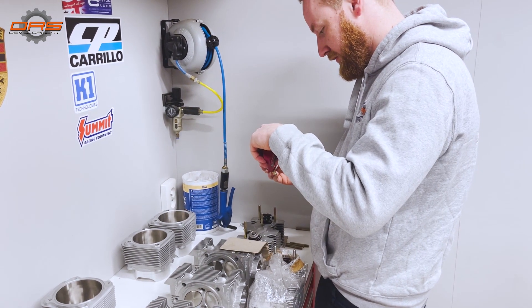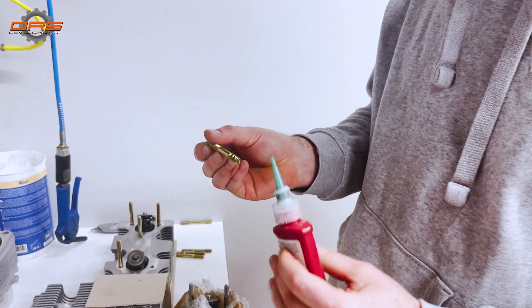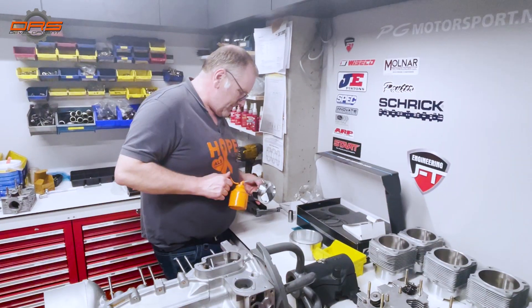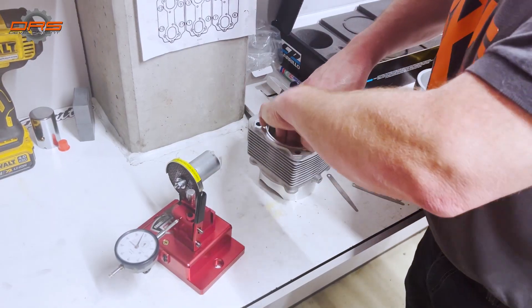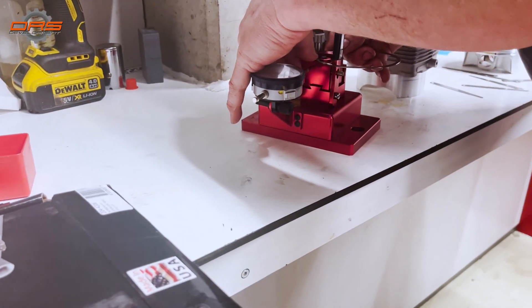We roll-plate all of our head studs — everything on the engine is redone. I used a little bit too much glue on this one, but I took it off, no worries. Philip is assembling the piston rings and the pistons, again with a little bit of sticky oil just to make sure that when running the engine has enough lubrication until the oil pump builds pressure.